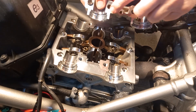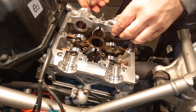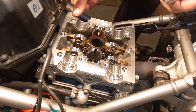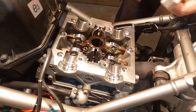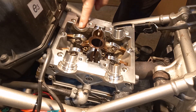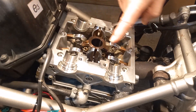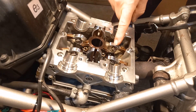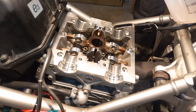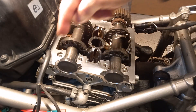This area here you need to put a little bit of silicone because it doesn't seal there. This part sticks right out to the edge, so it can actually leak between the two parts. Just put a little bit of silicone here before you fit the top cap on. We'll put a little bit of oil in here — this is where the oil comes up, gets pumped through, fills up on the cam, flows inside the cam, then drips out onto the valves and onto this area as well. Put a little bit of silicone in the corners.